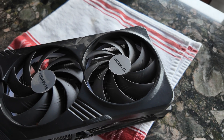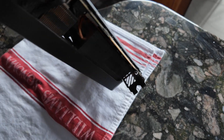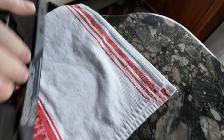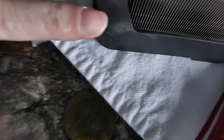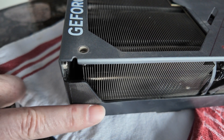I have the replacement fans, but I'm hoping I don't have to take the heat sink off. So let's take a look at the underside. There are six screws, and I do have a right angle screwdriver. I can see one screw, two screws, and the others — but we have one problem. This one over here on this corner, you can't even see it, but there's a screw down there and you have this flange in the way.